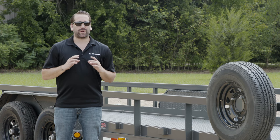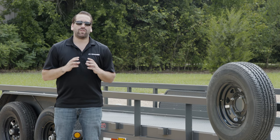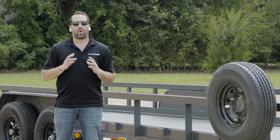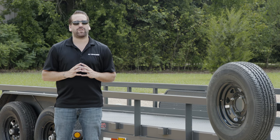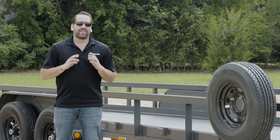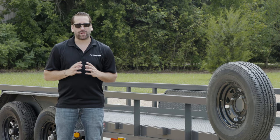Tires in regular use excrete oils and lubricants that help to maintain them over the span of their life. You should avoid parking your trailer on concrete or asphalt for extended durations of time, as this can allow flat spots to develop. According to experts, this can cause eventual tread separation no matter the tread thickness. Be sure to regularly inspect your tires before you head out.